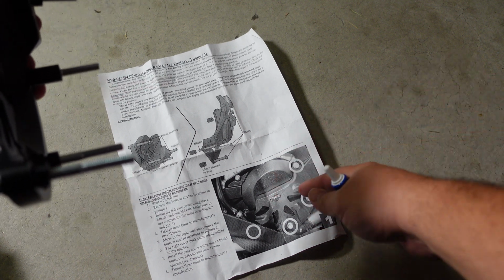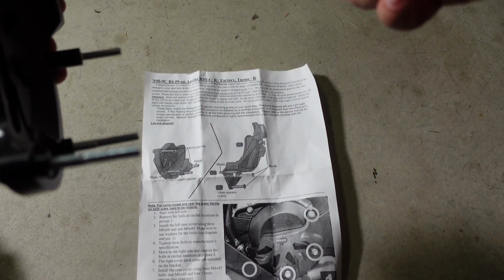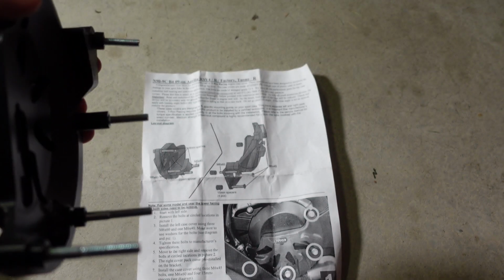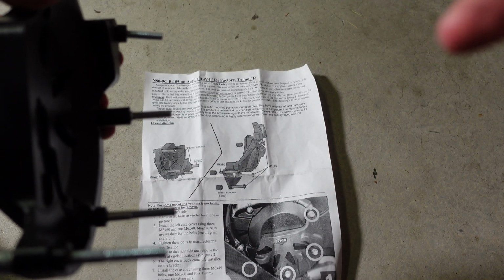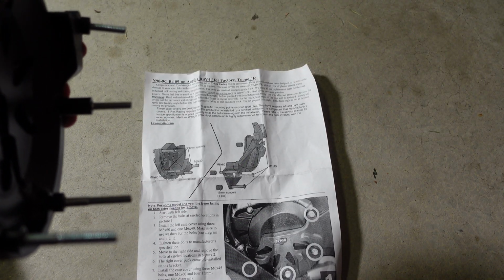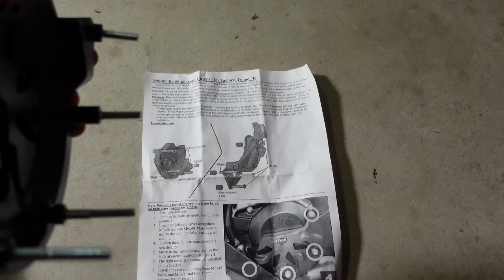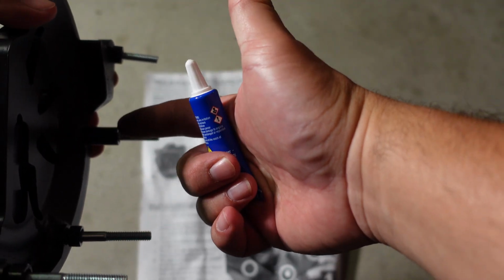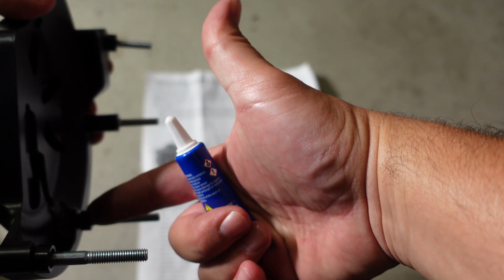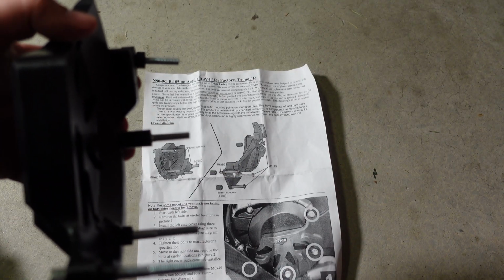So you have 6 millimeter spacers at both ends, and then a 20 millimeter spacer right here, right? It comes pretty much pre-assembled, especially at both ends, and just follow it through. It's going to be M6 by 60s all around, right? You just need to make sure you're getting the 20 millimeter spacer, and that you're getting the 6 millimeter spacers assembled, right? So don't forget that as you put it in.